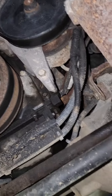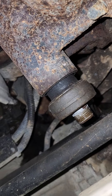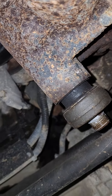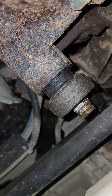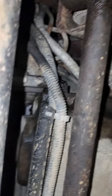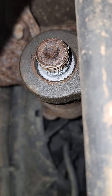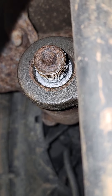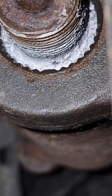Go to your Pittman arm right here, take that nut off. You can lift up on the dust boot right here — that black thing — it'll go up in there, but I just take the nut off, it's easier. You can see the whole diameter of it. Go underneath this crossbar and there's the threads.